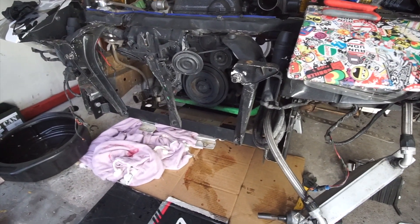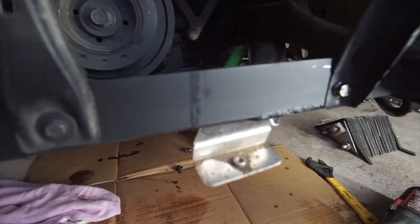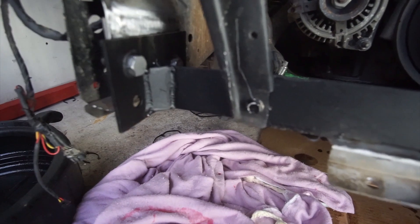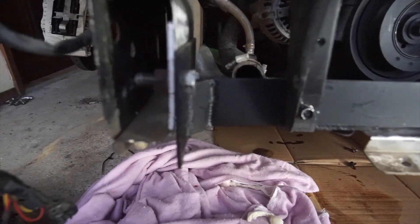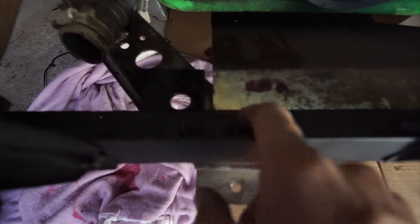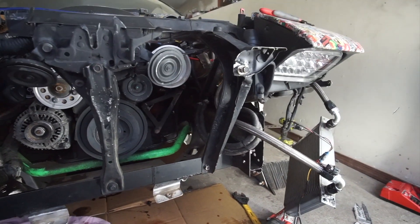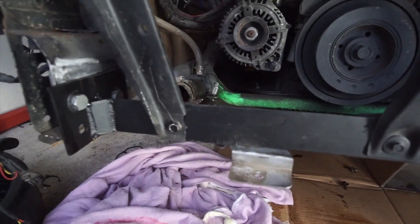Pretty much the radiator is out. I wanted to show you guys the lower radiator support that I custom made — it's pretty nice, held up pretty good. I used an L-bracket from Home Depot and created a base plate to bolt up into the chassis. Pretty simple process. Reinforced it with some tack welds on both sides, and also added the bolting point for the power braces, headlight bracket, and hood bracket. This thing is a lot more rigid than the OEM one — the OEM one was way too flimsy and broke in two spots.